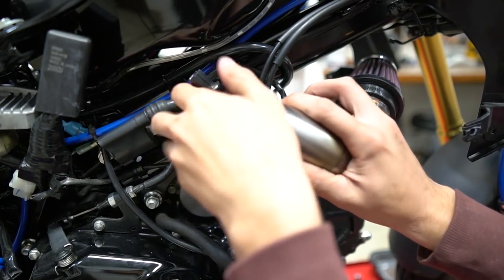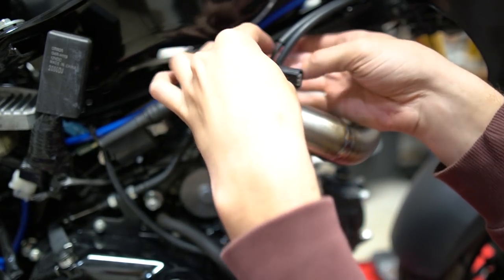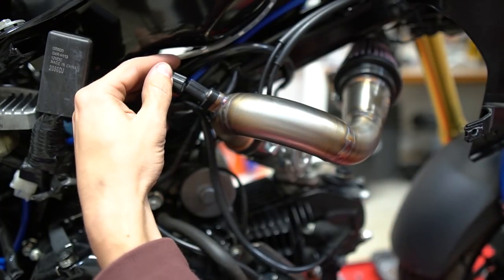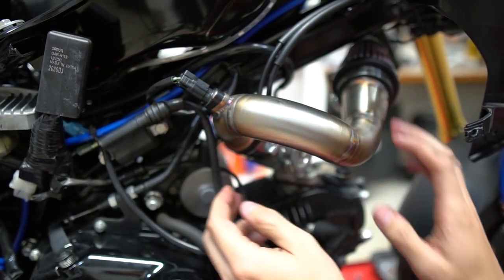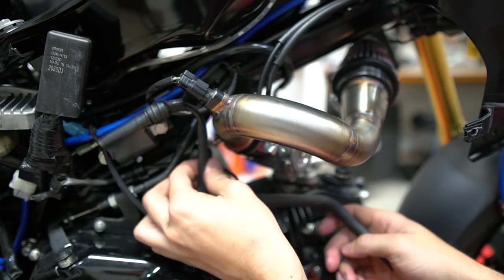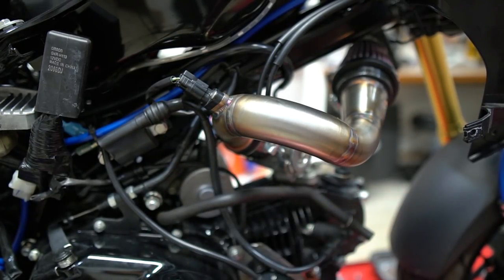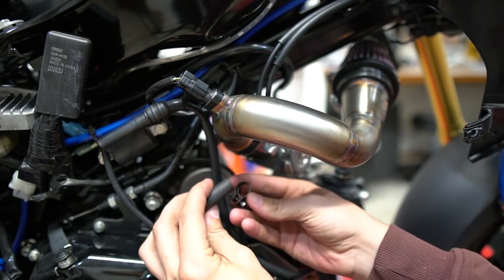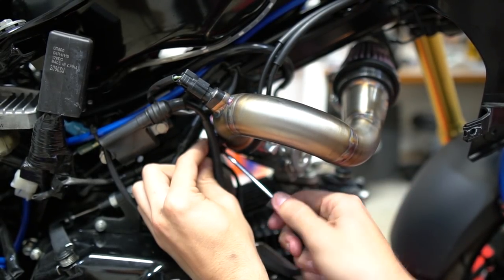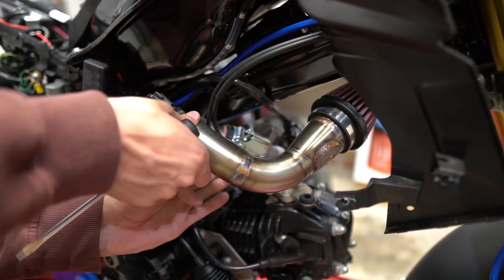And there's that. Now we're going to plug in the sensor — I'm just going to move the sensor wire over to this side and plug it in. The breather hose is way too long, so we're going to need to shorten it. It just goes to the little breather port on the bottom of the intake right here. I'm going to use a hose clamp I've got sitting around and slide it on where it goes. Now we're just going to tighten down everything, but first we're going to push and make sure everything is sealed properly.